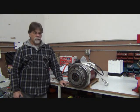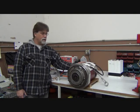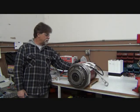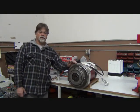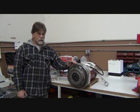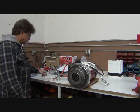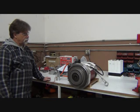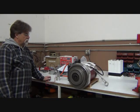We've got the motor out and on the workbench. We inspected the brushes — they're wearing evenly and everything looks good. The commutator looks good too. So we hooked it up and ran it on the bench with 12 volts just to hear what it sounds like with no other noise. Nice and smooth and quiet.